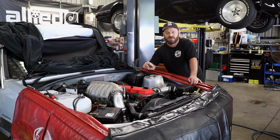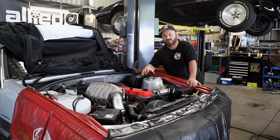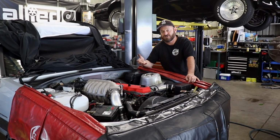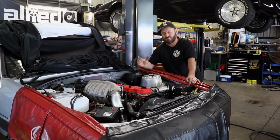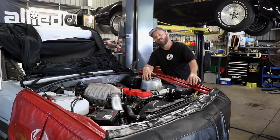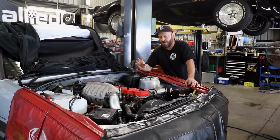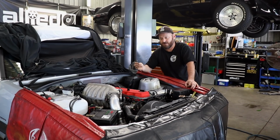Oil pressure. It is always best to try and achieve oil pressure just by cranking the engine before you try and start it. Some engines will not do it. They need to be at a certain RPM before they'll achieve oil pressure, but getting some circulation through the engine is desirable. You should be able to see oil coming through your top end, so you know there's at least circulation through the engine and everything's lubricated. And then monitor it once you start it up. It shouldn't take long to get oil pressure.